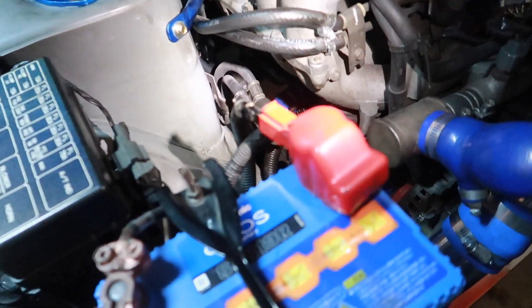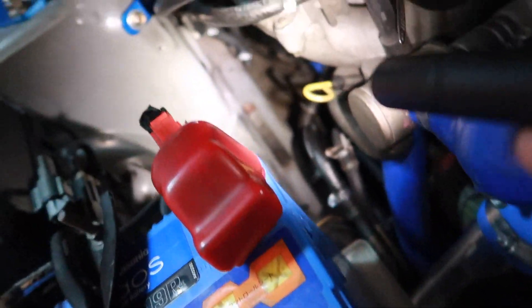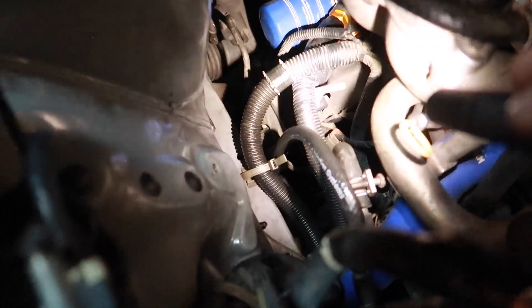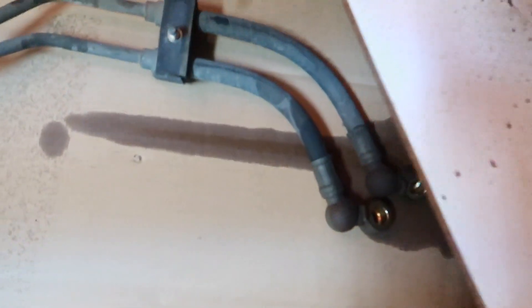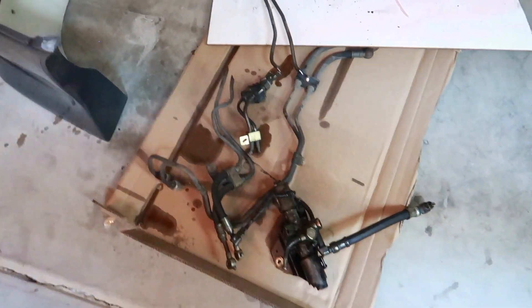Now all I have to do is remove the remaining power steering lines, put power steering fluid in the reservoir, and bleed the system. Finally got that out of there — look at that nice crevice. Hit it with some degreaser and cleaned it up, as well as the rack and pinion and anywhere else power steering fluid got to. Very clean, very accessible. This is everything that was deleted — all the HICAS. I ended up cutting the hard lines to get that part out. Probably shed about 10 pounds, but now it's all good.